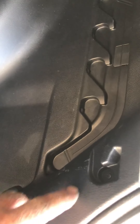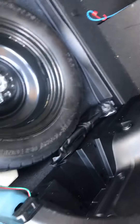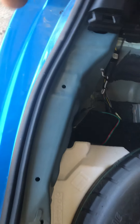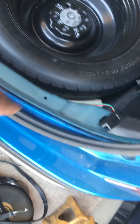Same thing on the right side — the screw holes and everything are identical: Phillips, 10 millimeter, 10 millimeter, 13 millimeter, 10 millimeter. This is after you remove all of the contents from in here, so just pick up the whole center panel thing and pull it out and get it out of the way. The rear fascia piece which sits here is all on clips — just be gentle.